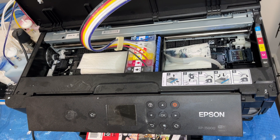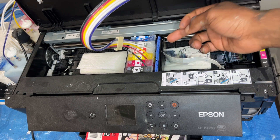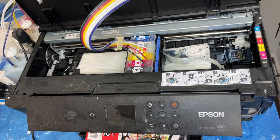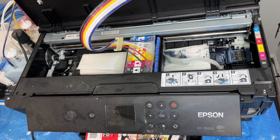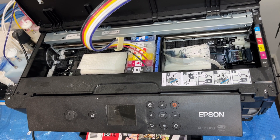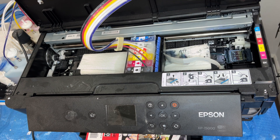This is why these other colors never dry — they don't have that settlement. It's not the SIS system. When you're not getting any white ink flowing through but all the other inks are flowing, your printhead is clogged. There are little holes on the bottom and the settlement gets in there and dries up fast. This is why when you get white ink in the bottle, you have to shake it — shake the bottle so the settlement mixes in for better printing.